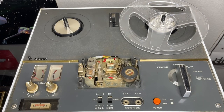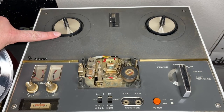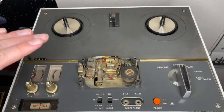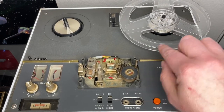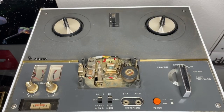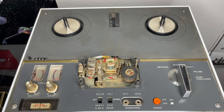So we're going to keep that reel right there — that'll be our take-up reel. Now this deck has a peculiarity: I believe this hub is a little lower than the other one, which means as the tape leaves the supply side and goes onto the take-up reel, it's got to go down a little bit. As the tape starts to spool onto there, it will sometimes rub and squeak on the edge of the take-up reel, which is annoying. I've tried to combat it by stacking a piece of felt paper under it to raise the lip, but it's minimally effective — really not worth it.